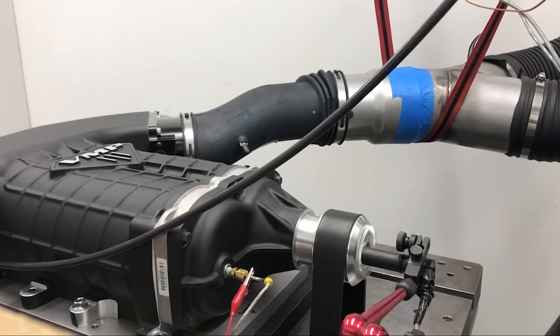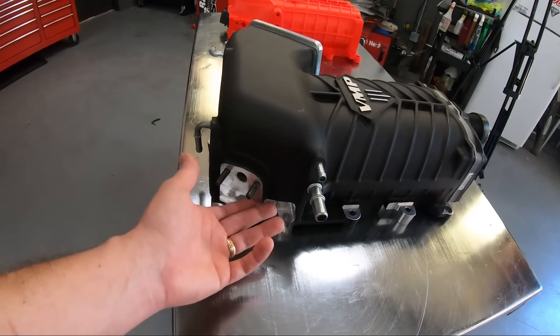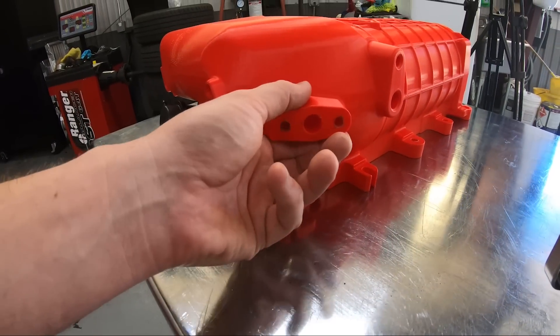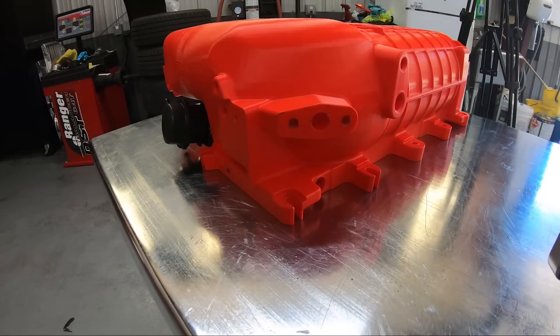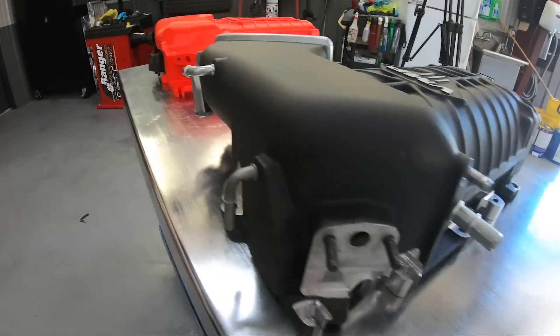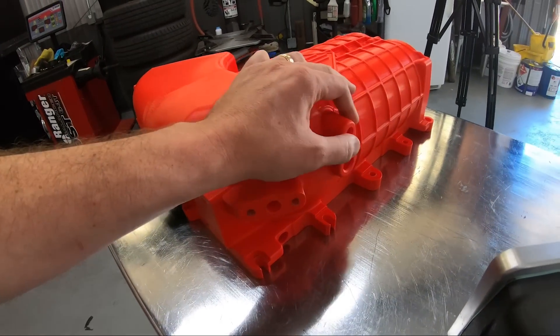The inlet is really important to me because we were able to make a lot of improvements there and we've already quantified those results. We made a bunch of other little tweaks too — some bolts that were hard to get to on the Gen 3 are now taken care of. This area is kind of big and blocky where the EGR goes on the Gen 3, but on the Gen 3R you can see it's much more lightweight and trimmed back. The pad for the EGR is just sticking out of the casting right here.